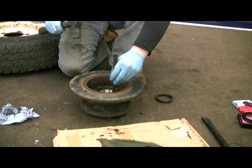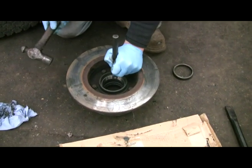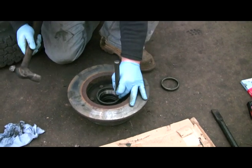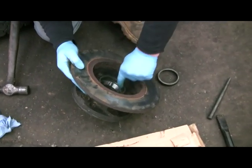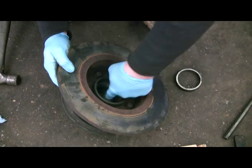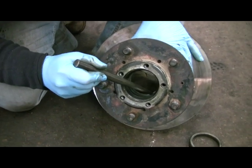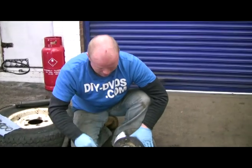Catch it on the edge of the track — keep it pulled to the edge of the hub. Nice and firm, take your time, because you don't want any damage to the track. That is the lip that you don't want to get the old track caught on — it's got to go about another millimetre. You can see the back edge of the track; it's got to be flush with this lip that it sits on. That's that. Good chisel for that one so it doesn't slip off as you're tapping it in. The front one's nice and easy — it's closer to the edge.